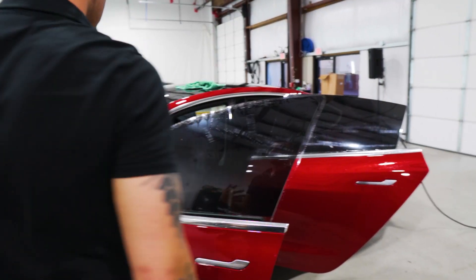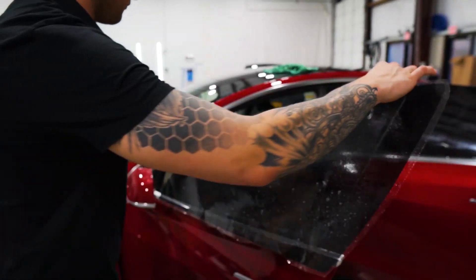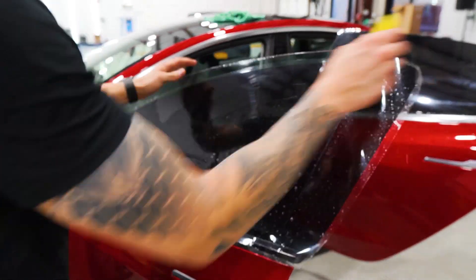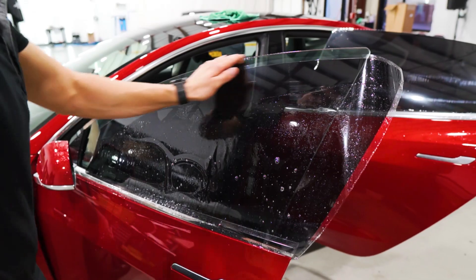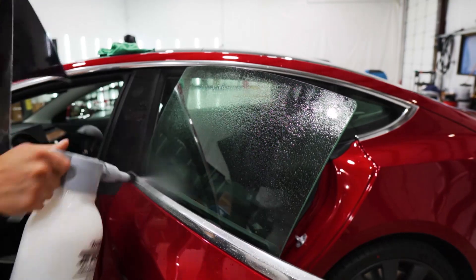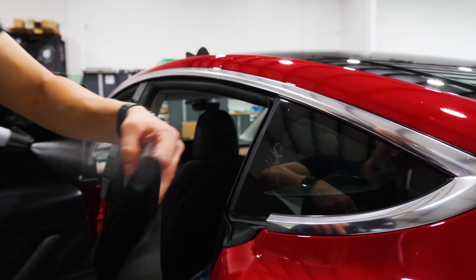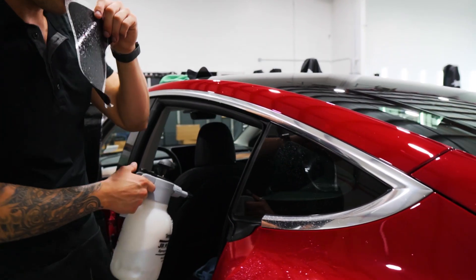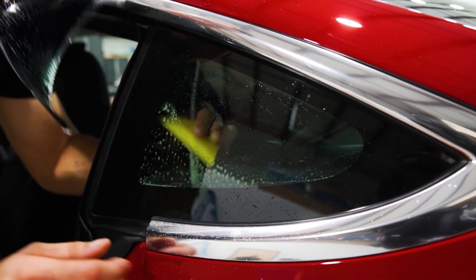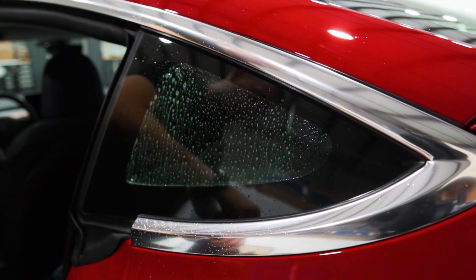Once the windows are completely shrunk, release them, spray a little soapy water, and mount it as you're going to grab it from the window during install — about an inch from the top, overhanging the back. Install the quarter glass windows while this window cools down a bit so it's not too tacky. Grab the quarter windows and do an air peel — spray, squeegee, spray — then peel the liner.